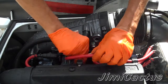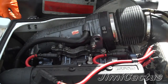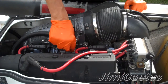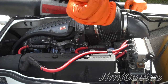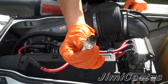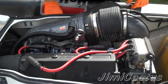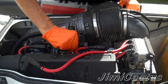Pop it off the top to get a little more leeway, then take this one out. There's how she looks — actually not too terrible. You're going to see a little bit of oil because the oil and fuel are mixed together; this is a two-stroke. But the new spark plug gapped properly is going to make a big difference in the way she runs.